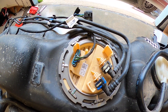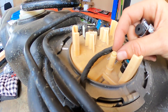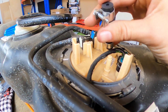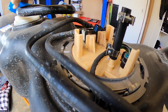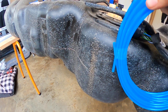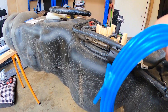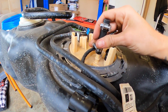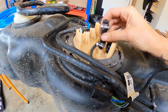So yay if you're with me and you've got the new Sprinter because we don't have to do that. We're going to go into this fitting - we're going to snip off just the very little tip of that. What I've got here is a hose which is thick on this end and thin on this end, with a couple of clamps. Our blue hose is going to go into here and essentially I'm going to drop it down in there, but I'm going to make sure to not drop this hose right to the bottom. I want to drop it just a little ways down so that no matter what, if I'm running my heater, I'm not going to run my vehicle's tank to empty and I always have enough to get out of camp.